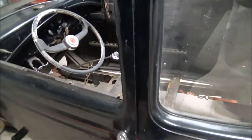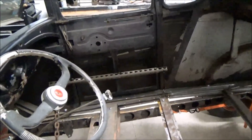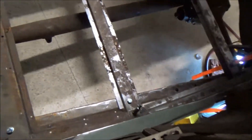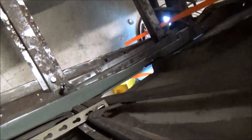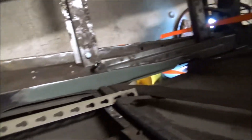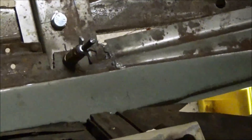So that's coming along. I'm going to grind that off and clean it up. It doesn't open very well when you weld braces in. This subfloor or subframe — whatever you call it in these Model A's — is basically a frame for the bottom of the body and the floor. That rear rail there has been replaced. It was welded right there, which looks like it needs to be cleaned up.